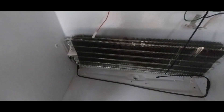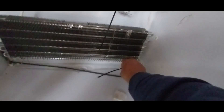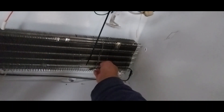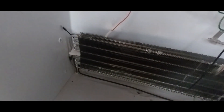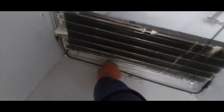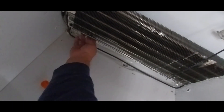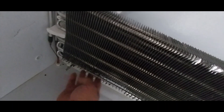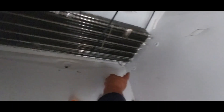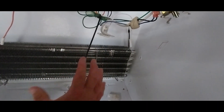As you can see, it went between here — that's where the other one came through, so we're doing the same. It's going to go through here and I've got to set it through those straps. They work like a zip tie: the bottom slips through the hole and you pull it tight and fold it — that's how the heater element stays up in there. Pull it up and fold it under — that keeps the element right at the bottom of your evaporator. Then I've got to put the styrofoam back in, which locks where everything sits.